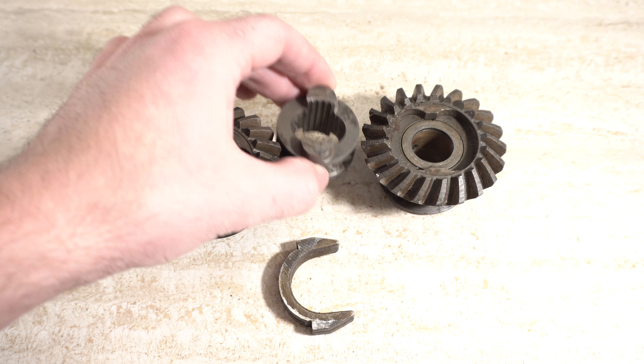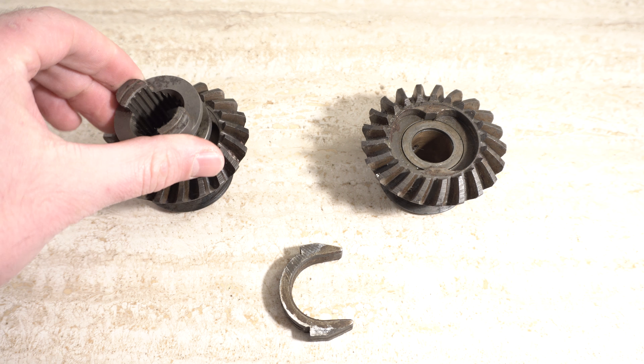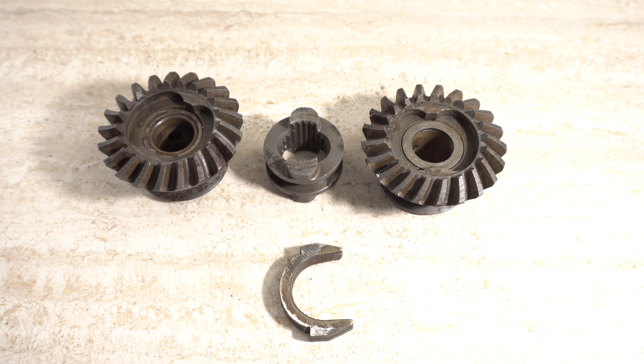This explains why when you put it into forward or reverse it's a little rough. This is not like a car transmission where if you let the clutch out slowly you can go into first gear without any vibration or thump — it can be perfectly smooth. With an old outboard gearbox it's normal to have a bit of a clunk. You don't want a loud clunk, but as you put it into gear you should get a little thud. Once it fits in, it literally just grabs the gear and makes it go. There's no smooth connection — it's grab and go.